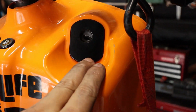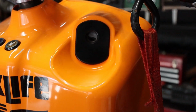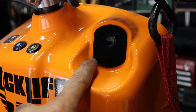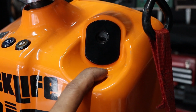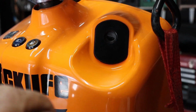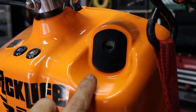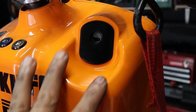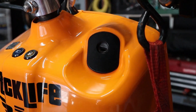So a little side note, I redid the key cover. It was black before. I tried to spray paint it orange, but every time you missed the key it was chipping and it looked terrible. So I haven't had it on in a while because I was gonna buy another one, but then I got all this sandblasting and powder coating stuff. So I sandblasted the anodized black, which by the way peeled off instantly. As soon as it hit, the anodized was gone. I made it entirely gray with an awesome surface and then powder coated it black. I probably should have done orange, but I like the contrast. I mean, it's obvious where the key goes, right here. Anyways, let's take a look at the next part.